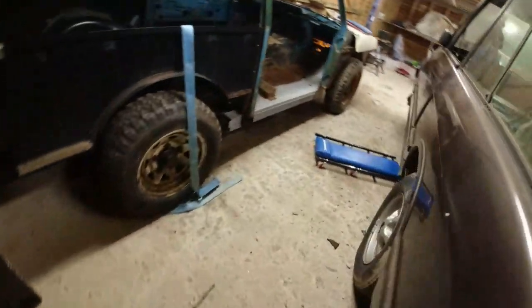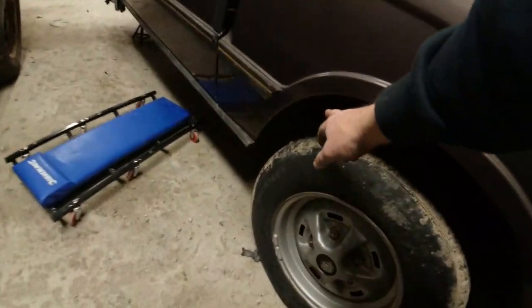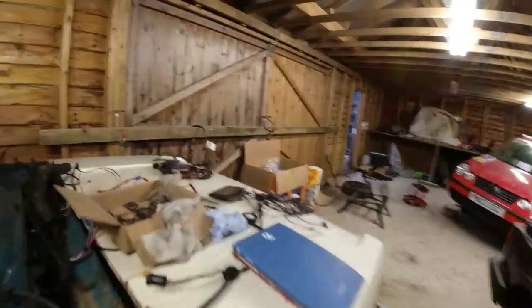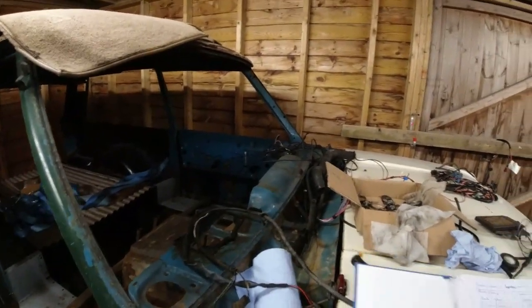Right, so found out first and foremost that the tank, already confirmed it was plastic. Remove the plate from the middle of the boot floor, which you can just about see there, and then there's a connector, and the connector is what keeps the thing separate. There's the loom end of it there. The sedimenter is attached up onto this wing here, which is what I would have expected for a VM engine. Then what I did, well, then I had some fun.